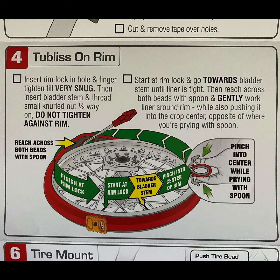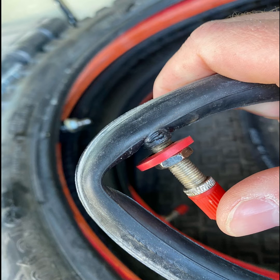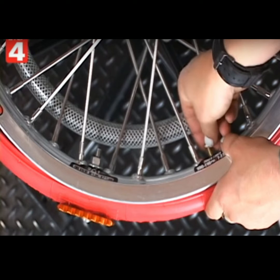The stem can be stressed in two ways if these are not followed. The first is that the high pressure stem can be stretched too far when putting the system on the rim if the valves are 180 degrees apart, causing stress to the base of the valve stem. Having the stems as close as possible allows you to put both stems through the valve holes together, avoiding any stretching at the base of the high pressure valve.